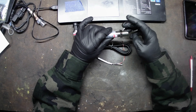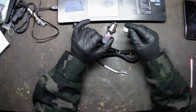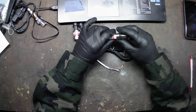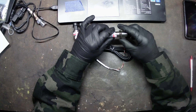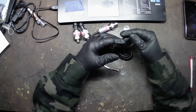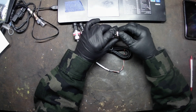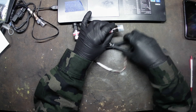Whether or not we're good at what we do remains to be seen, but this sensor is more or less just to keep me in check during the burnout. When I'm rolling up towards the beams I'll still get a second tire temp and track temp check. As the tire comes up to temp in the burnout it tends to gain a little heat even rolling out of the burnout. So if we're shooting for a generic number like 150 degrees, I'll stop the burnout at around 120 — the heat will still be getting into the tire as I roll up, so I don't sit on the starting line and annoy everybody.